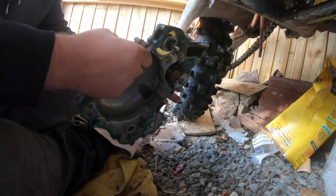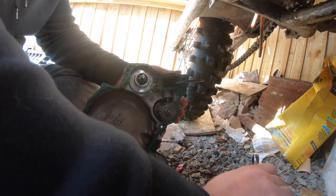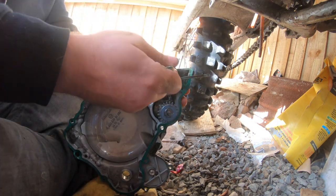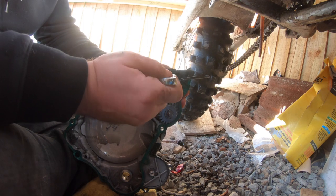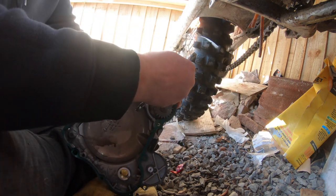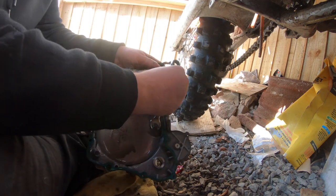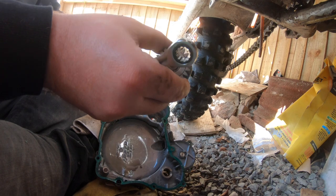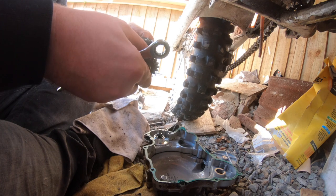The way I've done it: I've had to undo that bolt - be careful, there are a couple of washers underneath as well. Then use a 10mm ratchet to go onto the hex inside there. Working that is pushing the bearing out, which isn't a problem because it will help, and it should just pop out just like so - which then frees the little beast up. Take note of what position things go in because you never want to be in a situation where you don't know where things came from. There's the pin right there.